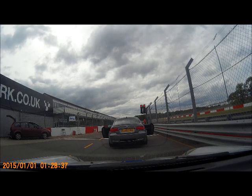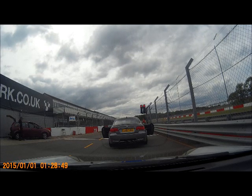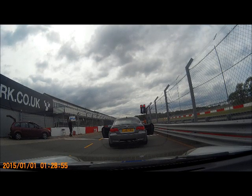I notice it in two places: at Redgate and at Old Hairpin. But bear in mind, this is a circuit where if you had a race car with a standard setup that you use at all the tracks, I would soften the front or stiffen the rear here to give the front more bite, because you've got 4 corners that really require really good bite, particularly the Old Hairpin.